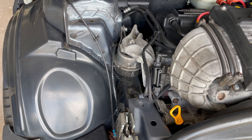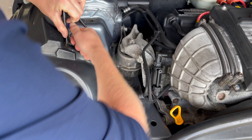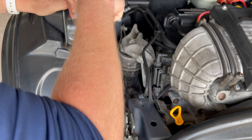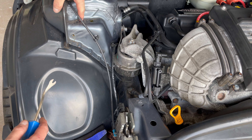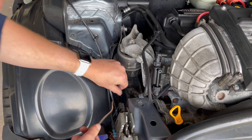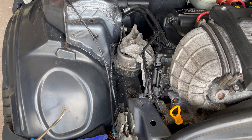The strut brace bolts in here and down here. We need to get these caps removed first. Try a plastic trim removal tool and see if you can get underneath to get those off. Sometimes you can't and you've got to get a little metal one in to pull them out. That's one cap out, and we'll get the same one out up here — that's two out — with little threaded sections in there. There are two further ones just down here; we'll remove those as well. Try not to scratch the paintwork too much if you're using a metal tool.